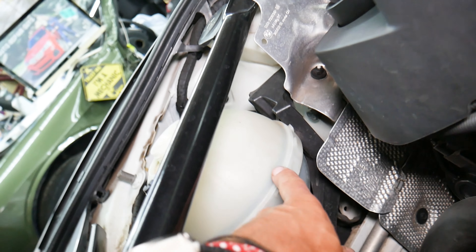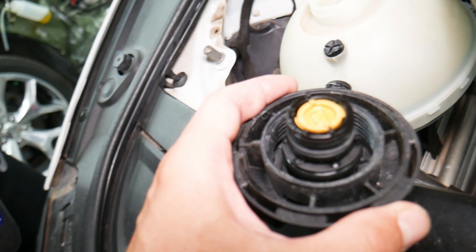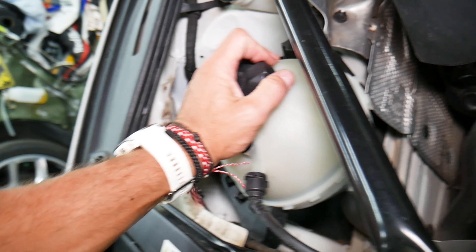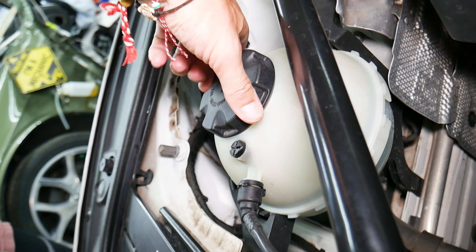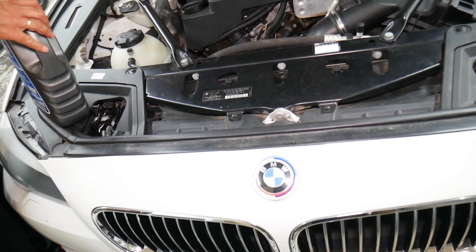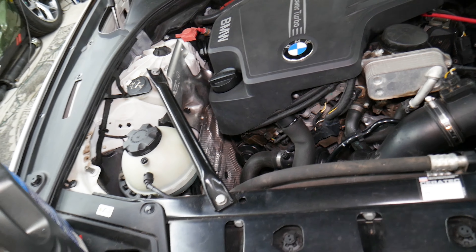So we just keep adding. We keep adding — and stop. That's the maximum; you can see it right here. Inspect your seal, inspect your cap. Everything's good, you're ready to close it. That's your whole procedure — it will only take a few minutes. Make sure you close the cap all the way; towards the end you will feel it kind of skip and get all the way tight. That's how you add coolant on a BMW 5 Series. Hopefully the video will be helpful. Thank you for watching. See you next time.